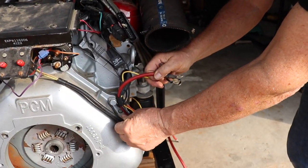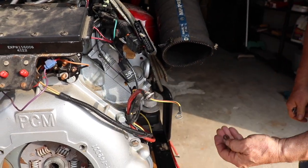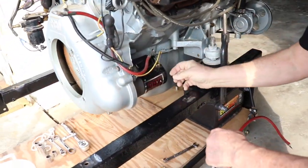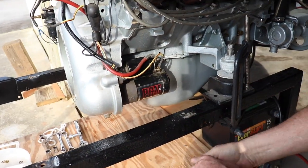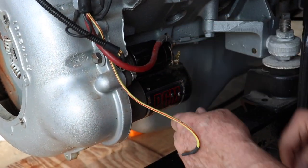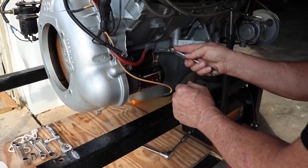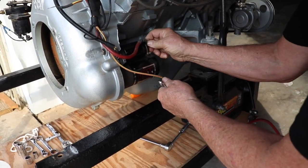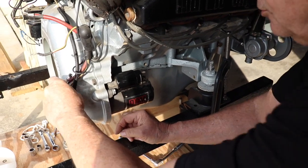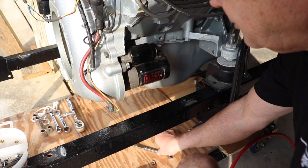There's a bracket that holds all these wires together that holds the bell housing on. When we take this bolt off, a lot of this stuff will come out of the way. Next, we're going to go ahead and remove the starter. This is a permanent magnet starter — it's got two wires that come down to it. One is a spade connector; you just pull the spade off. The other wire goes up to the starter relay and uses a 13mm wrench on this particular starter. Once you have the wires removed, there are two bolts that hold the starter to the bell housing.